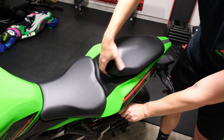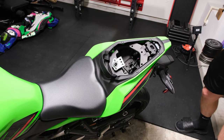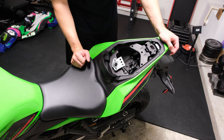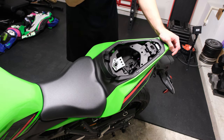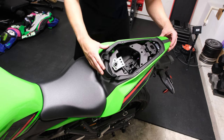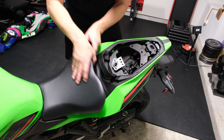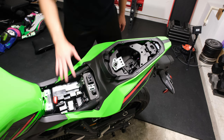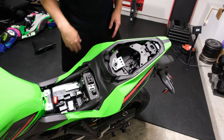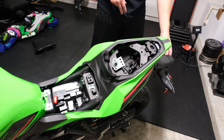For the rest of the bike we're going to be buying high quality parts for sure. For the rear fender, we're going to start by putting our key in to release our seat at the top — it'll pull up in front and you can just slide it forward to remove it. The quality of everything on this bike really impresses me. This is the only Kawasaki I've had that's made in Thailand — all my others have been made in Japan — but this is the best quality of any Kawasaki I've had. I'll remove this black plastic trim to get better access to the cords needed for the blinkers and license plate light.